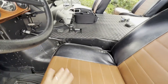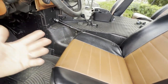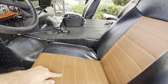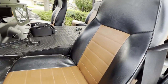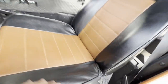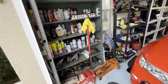Another issue I was having when applying the clear coat: I'd cover it, come back the next day, and see white lines where the stitches are — just white lines, which was weird. Maybe the clear coat pooled more there than needed. So I took the brown paint, covered those white lines to make them brown again, let it dry, covered with clear coat again, but the next morning they were white again. What I ended up doing is taking a very thin narrow brush and just carefully covering the stitches themselves with brown paint without clear coat on top, and that fixed it.